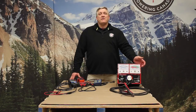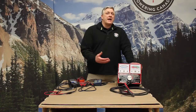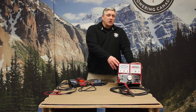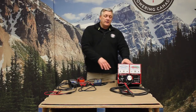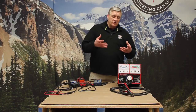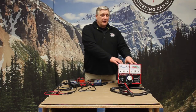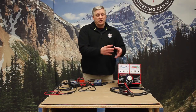Typically, more amperage is what a vehicle is going to draw. It actually pulls amperage out of the battery depending on how much you want to draw out of it, and that would be adjusted by the dial on the front, which puts more pressure on the carbon pile. So you can draw on this particular unit — the Auto Meter SV5 — up to an 800-amp draw on a battery, which is a huge load.